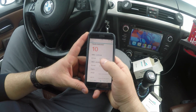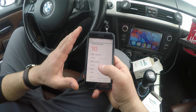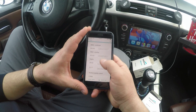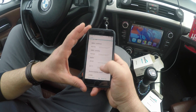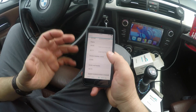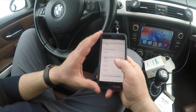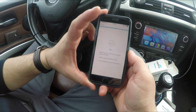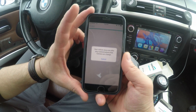Once it completes, there we have it — ten faults detected. The first OBD found one, the second V-peak found four, and this one found ten. There's P0140, two radiator blind activation faults, and others I haven't had time to investigate. I can see codes related to my reverse lights not working as well.